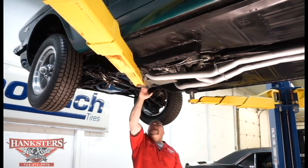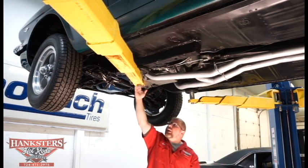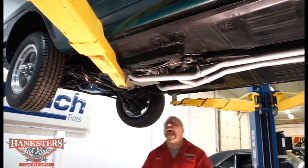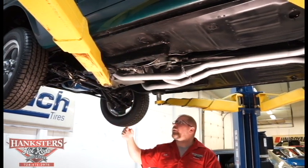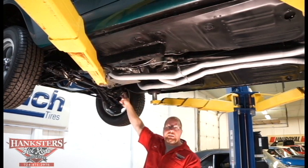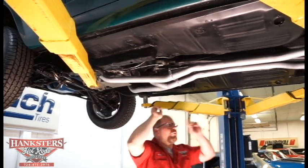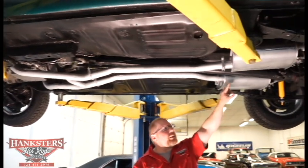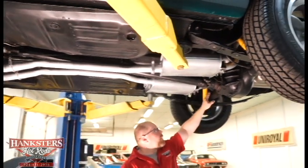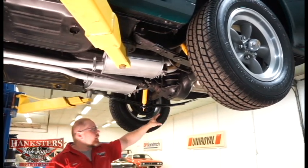That does have your cover on the front to protect your flywheel. So again, it does have an area for inspection purposes there, but you do have that cover there that helps protect that flywheel. As we come back here just a little further, a couple things. Exhaust we got hanging here. We've got, coming from this stock cast exhaust manifolds, dual exhaust. You've got your crossover pipe right here, and then of course those come back into a dual set of Dynamax mufflers. These are probably a turbo style muffler, and then of course you've got your tailpipes that go up over top of the rear end, and then they exit out that rear lower valance with a nice chrome exhaust tip back there.